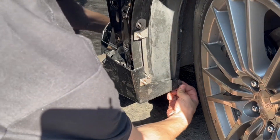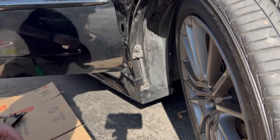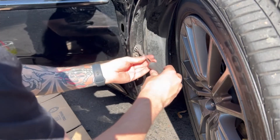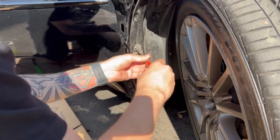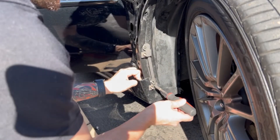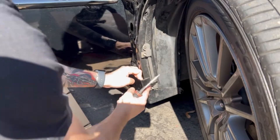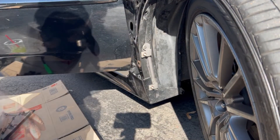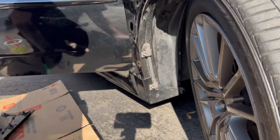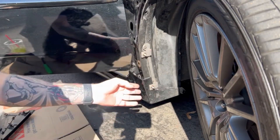With the plastic piece, it goes down in the corner and you push it all the way in until it's flush. Just the bottom two where the bracket's at. So after this, we tighten these flat tip screws until they're almost all the way tight, starting with the top one. You'll notice the bottom one kind of runs into the side skirt — just pull the side skirt out while you tighten it almost all the way down. Don't fully tighten it yet. Once it sits flush, the side skirt will go over and not run into the screw. After you get them mostly tightened, push the bracket towards the inside of the car and you'll notice it slide over a bit. Once that's done, fully tighten the screws and then push the side skirt back in.